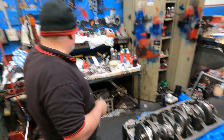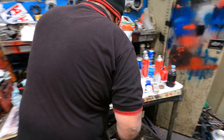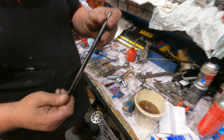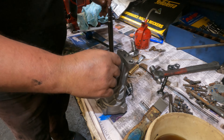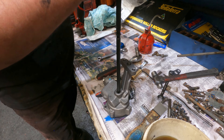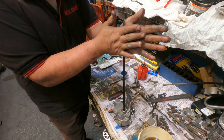I'm going to show you another way of doing it for people that haven't got one and they're on the go. This is the oil pump drive - it goes into the oil pump here like this, and you're physically doing this with the drill, spinning it around like that, and that's what primes the engine. You pick up inside the oil and it does that.